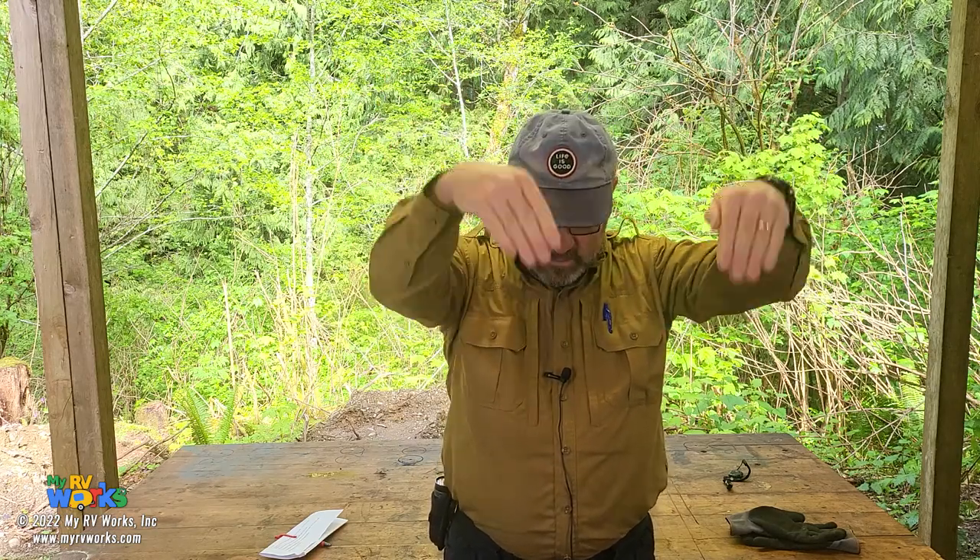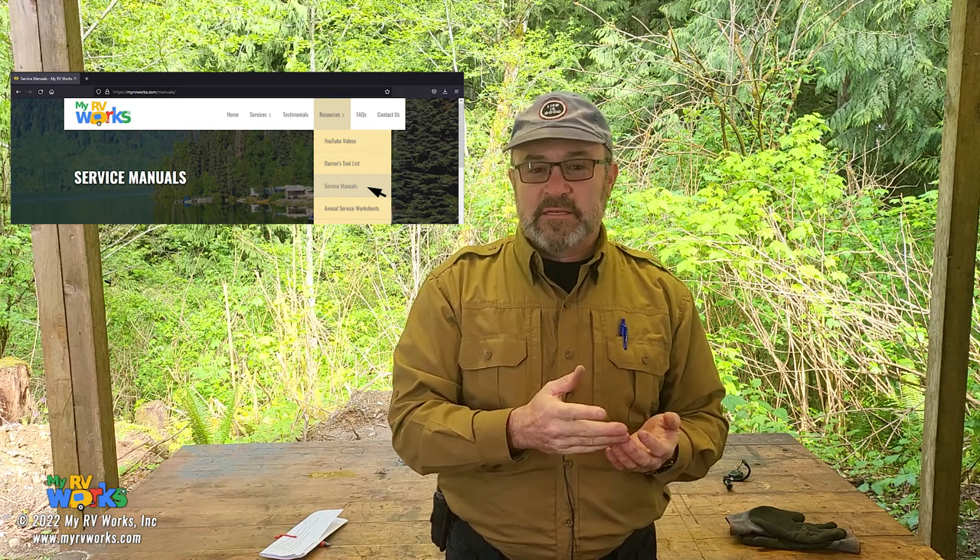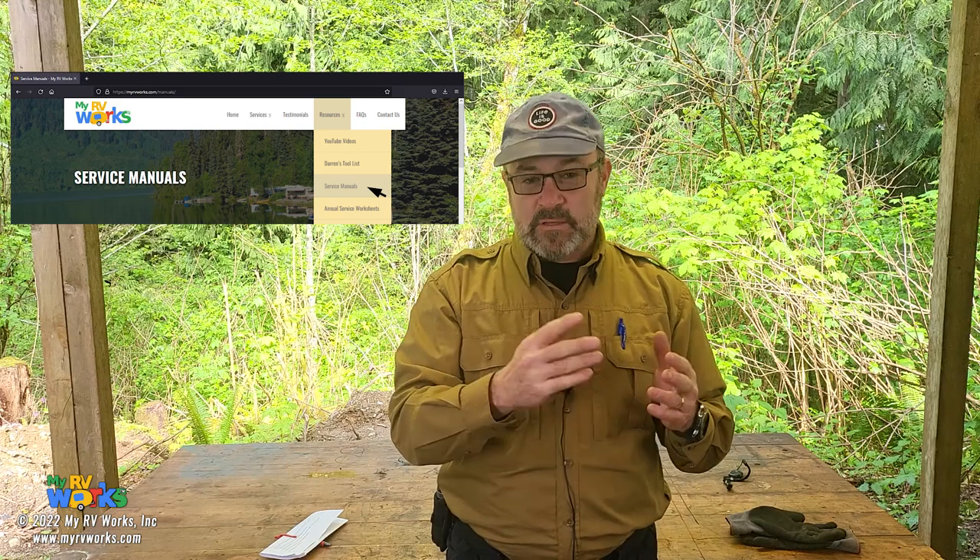I've done a video on ventilation and we did another refrigerator video where we actually installed the baffling in the back. What you didn't mention is whether the baffling is there. If you have that open vent on top and you remove it and can see straight through — there's your problem. You need to bring air in on the bottom, with less than a one-inch gap between the back of the cooling unit coils and the back wall of the refrigerator — less than one inch, zero is fine — and force that air through a baffle up through the top condenser fin. If the air is just dumping out before reaching the condenser fins, that's your problem. If that refrigerator cannot shed its heat, it will never perform cold on the inside. It's all about ventilation.